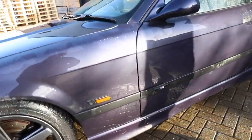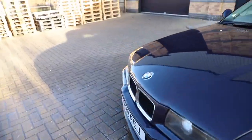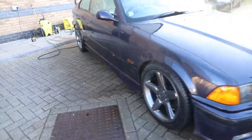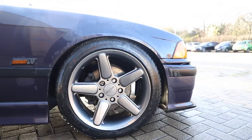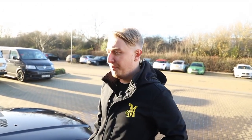The heavy duty cleaner is literally the best thing in the entire world. Look at all the dirt that was once here that is now gone — you can really see the purple actually coming out in the car. It's a tough degreaser — it's just removing all that dirt, grime, and traffic film. If you ever do use this on paintwork, always be sure to wax the car afterwards, because it may strip off a bit of wax. But for a dramatic kickstart to a detail like this, it's the perfect product.